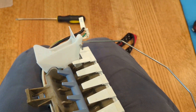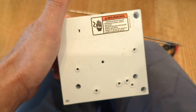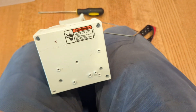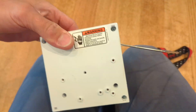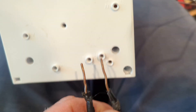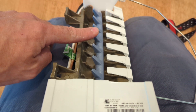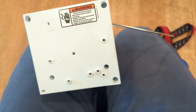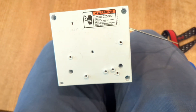There are a couple of ways to test it. Most of these mechanical ice makers have little holes with a T and H — that's for the thermostat. What you want to do is take a little jumper pin, while it's still in the fridge and plugged in, stick it in there. If you feel with your fingers, these paddles will start to turn, dump the old cubes, fill up with water, and start a new cycle.